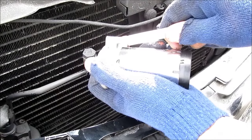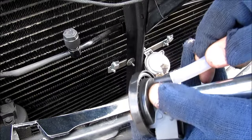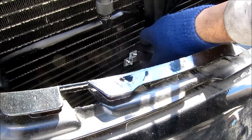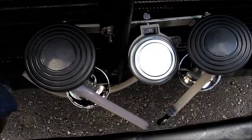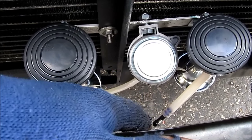Next I'm going to take my air compressor and install the hose, then mount the air compressor onto its mounting bolt. Next I'm going to take the hose and install it onto the air horn, then install the air horn onto the bracket. We've got the air horns installed on the bracket and the compressor, which is loose for now until we finish the electrical.